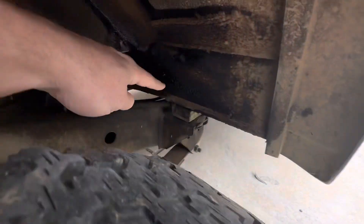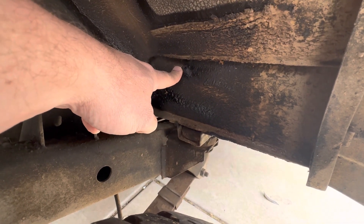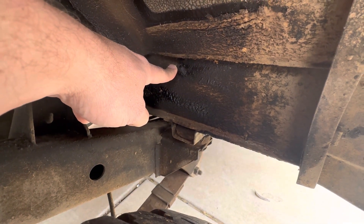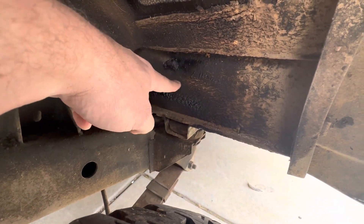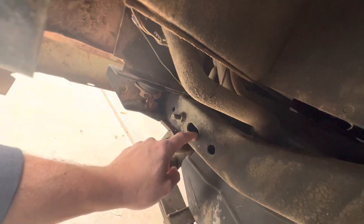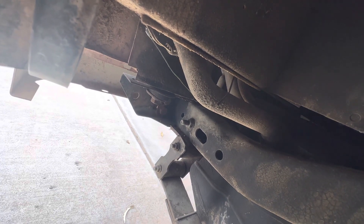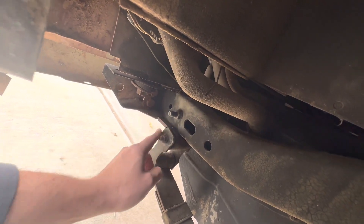This area right here — you can see the roll bar mounts just behind the roll bar feet. Even though you might not see rust around the roll bar feet on the inside, a lot of times the water gets captured in the back and stays moist behind the roll bar feet or on the bottom. If you look at this area from the outside it'll be bubbling out, so definitely be cautious for rust there. The shackle hanger area of the frame in the back is really prone to rust as well. You have holes in the frame where water gets in, especially if you're in salted areas — you'll basically have muddy salt water inside the frame and the frame will rust from the inside out. Check those areas for rust and be real careful.